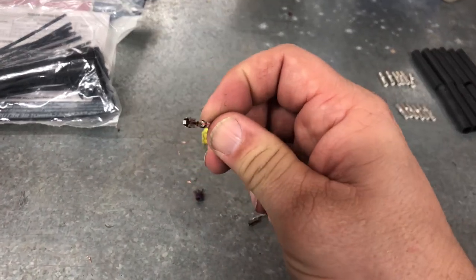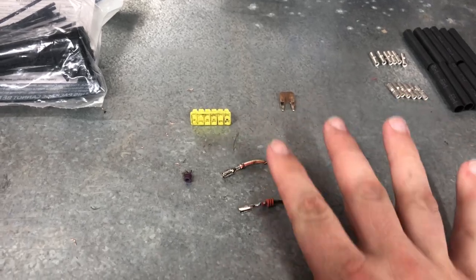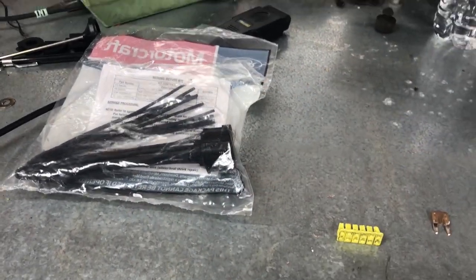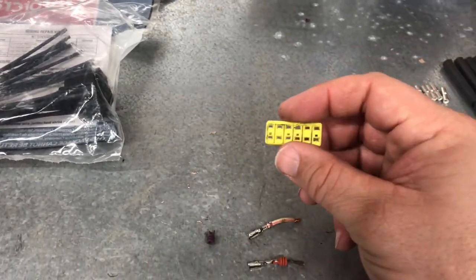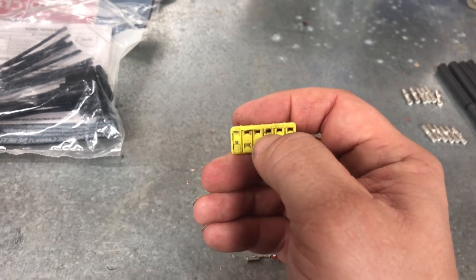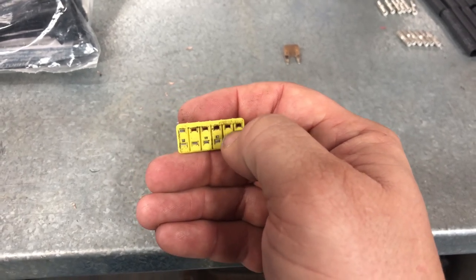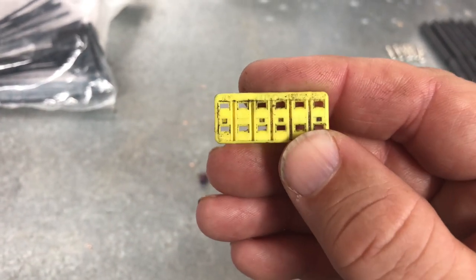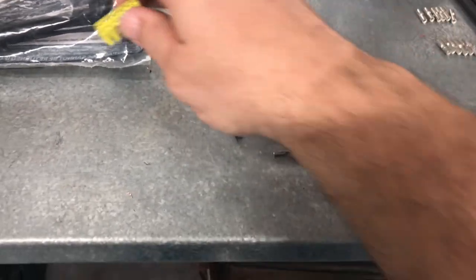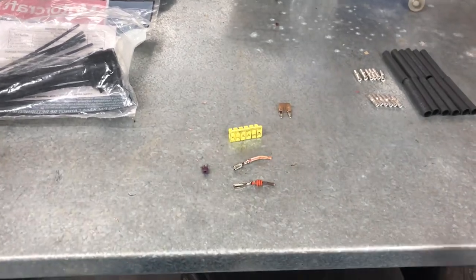With this one being opened up as well, it's not going to receive a signal if it's getting a weak signal from a very distorted terminal. So I went ahead and replaced both of these terminals with terminals from this pigtail assembly. This divider that was in that original plug - the third from the right is where the white wire with the pink tracer goes, and this is where the brown wire with the pink tracer goes. Both of those are opened up quite a bit more than all the other holes in this divider. So I took the terminals out of that pigtail and put them in there. Happy to say that it solved the issue - the car is starting up and running flawlessly.